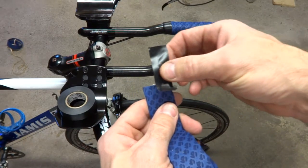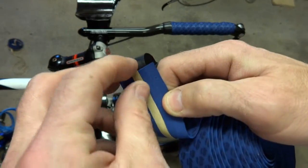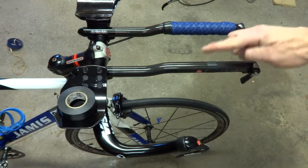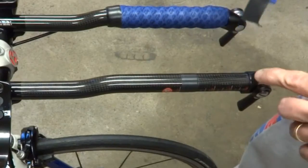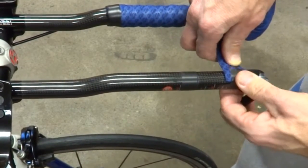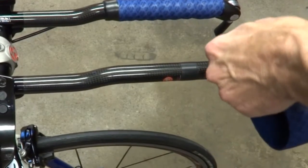I'm going to start by taking a little bit of electrical tape and putting it onto the end of the bar tape. This tape also has a little sticky adhesive on the inside. With the aero bar, I'm going to wrap it to the inside, starting right at the base of the shift lever, with the tape flush up against the base of the shifter. Then I'm going to wrap it around one complete wrap to completely cover itself.